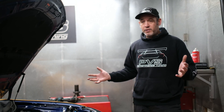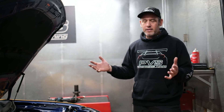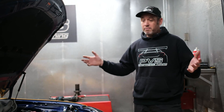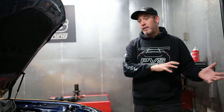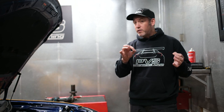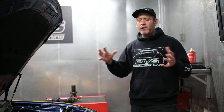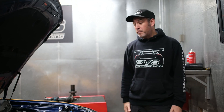It tuned up great — because we'd already done the 98 tune, all I had to do was a quick run over to make sure everything was fine. The flex tune has a lot more tunable features than the old two-liters. The ECU design and patch maps are a little more user-friendly, and you've got a little more control in a few areas with individual fueling maps and timing maps. The whole thing came together fantastic, so we'll pop over to the screen and show you the difference in the two tunes.